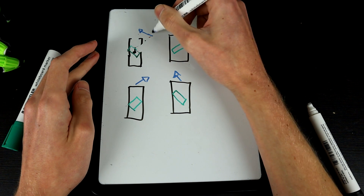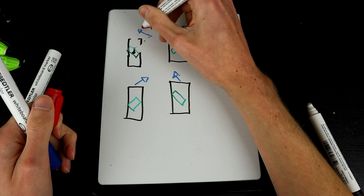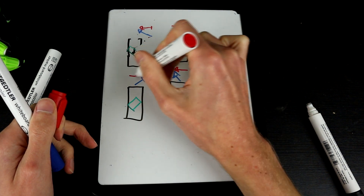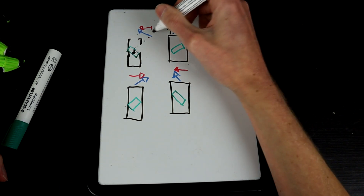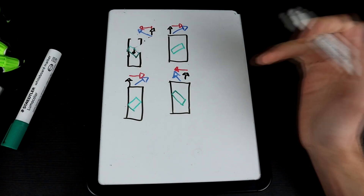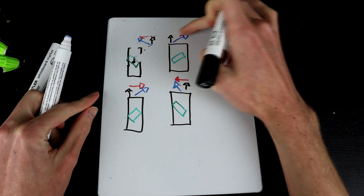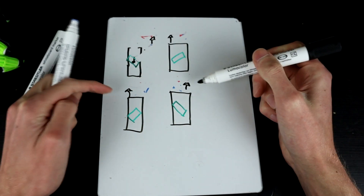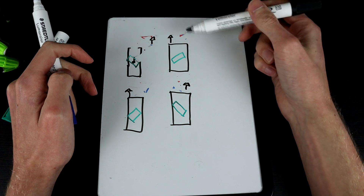When we do the force vector diagrams for all four wheels going forwards, we find components of force going in four diagonal directions. The lateral components — the red forces — are all equal and opposite, so they cancel each other out. What we're left with is four amounts of force all going forwards. If we then reverse the direction of the motors we would go backwards.